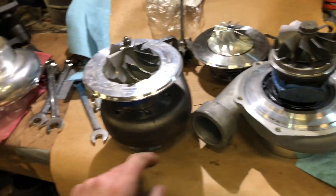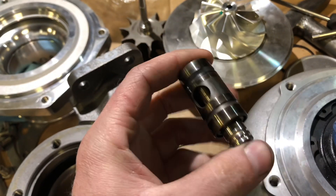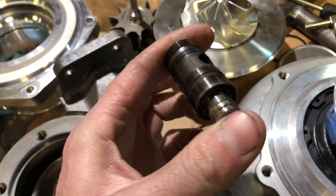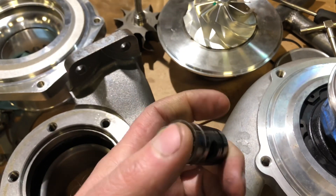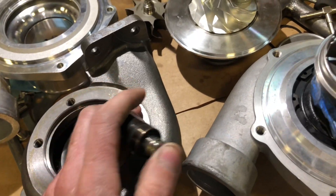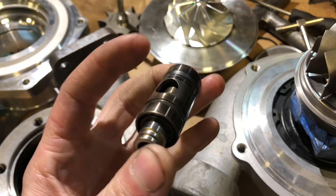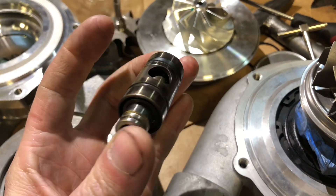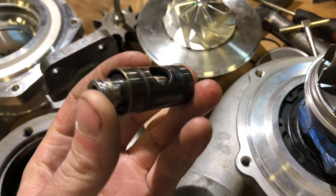This is the same thing as that, besides the anti-surge style. This is a ball bearing cage out of a Garrett GT35R — actually a GTX35R. This is the style of cage that would be in the turbo that we would replace in this turbine housing, rather than the two journal bearings, so that would be dual ball bearing with ceramic balls.